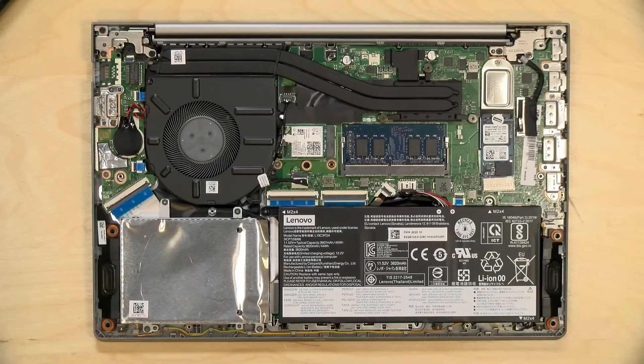Without that RAM, you're not getting the most out of this computer. When you're configuring this, there are options for a 16 gigabyte model — I would go with that, or buy the 8 gigabyte but get a DDR4 memory module to go with it. In addition to that RAM slot, there's also an NVMe SSD that's replaceable. This one came with a 256 gigabyte SSD, but you can upgrade that. On the lower left-hand portion of the laptop, there's an area for a SATA hard drive if you wanted to add that. So there's a good amount of storage expansion and some ability to upgrade the memory, which is going to be a necessity on this to get the most out of it.